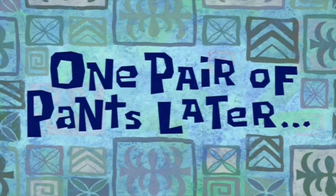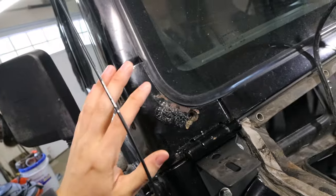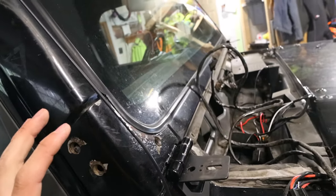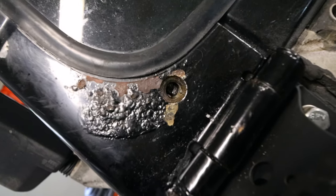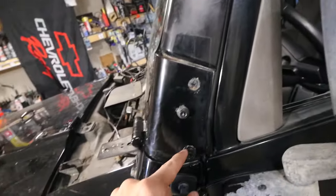Welcome to day two. A lot happened yesterday that I didn't film — frankly I would have been demonetized instantly from the library of swear words I screamed. As I was removing the last bolt on the windshield hinge to mount the new light mount, this bolt decided to snap — you can see what's left of it in there. The observant viewer will note there's silicone in there because years ago when I put on a different mount, the nutsert on the inside disappeared — same on this side. Luckily one is still there on the passenger side.